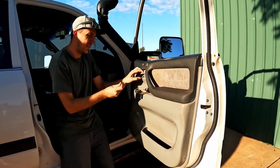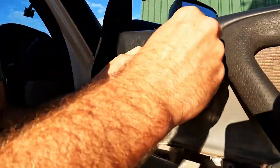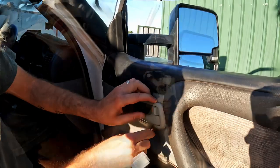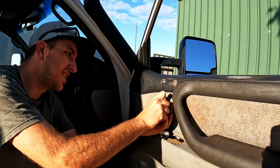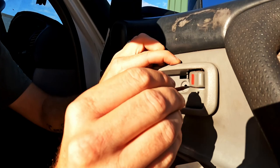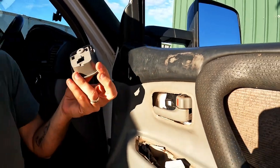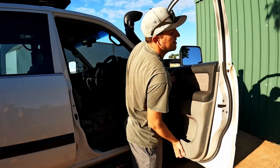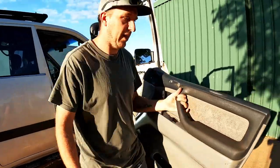Now this part is tricky — you've got to pull this outer casing off. If I remember correctly, it's clipped at the top and clipped at the bottom. Get in between the casing and press those buttons down to push them, then slide it off. So now the door trim can actually come off — just grab it and give it a lift and a wiggle. Get that out of the way for now.